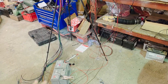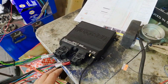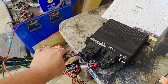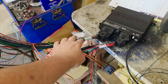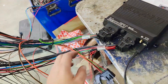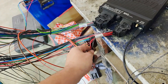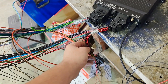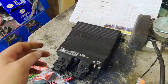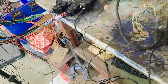So what have I done here? We've got a battery and an ECU. I've separated out the power, ground, five volt, and sensor ground lines out of the main harness, and I've separated out the throttle position sensor stuff, throttle body stuff, and pedal position sensor stuff out of the second harness, as per the diagrams. I think I'm now ready to put some power to it.